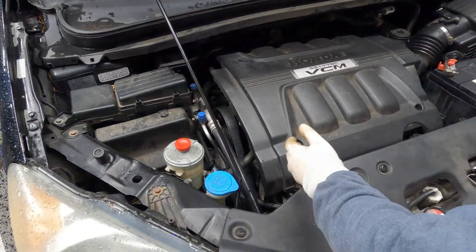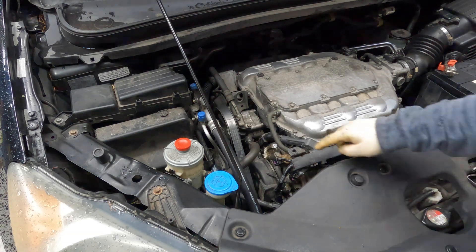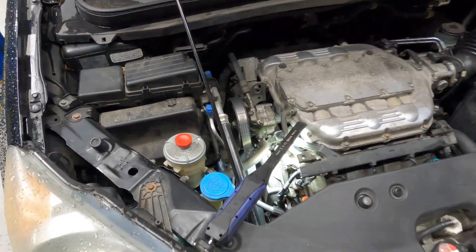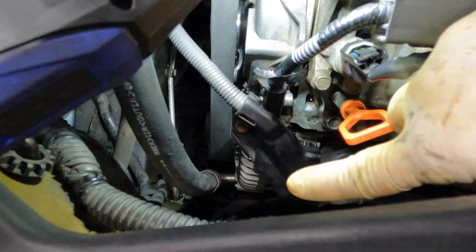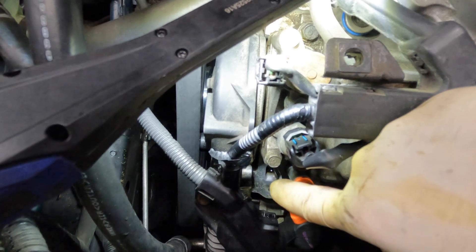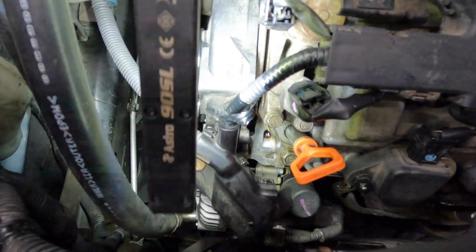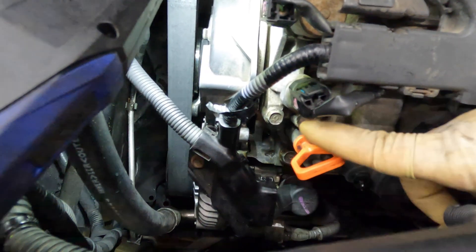Let's take a look at our vehicle and engine. I'll remove this beauty cover — I previously left it loose but usually they don't come off that easy. Our main area of focus is right over here. You can see our brand new alternator — nice and shiny. The valve cover gasket has been replaced too — you can see the little blue grommets, which typically indicates a Fel-Pro. And if we look in this general area, you'll notice there is oil there. What typically happens is the valve cover gasket leaks in this corner and gets all over the alternator.